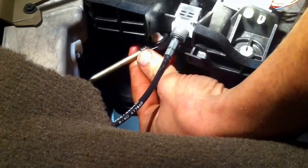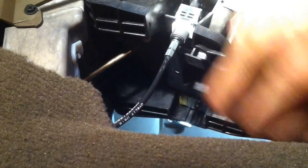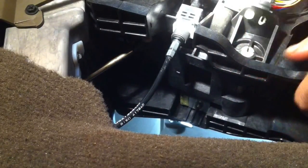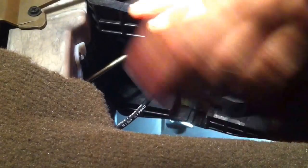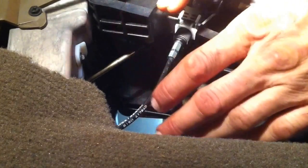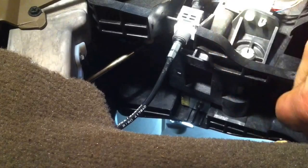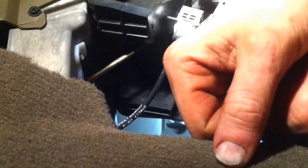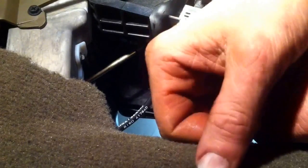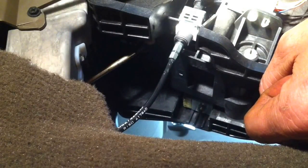As you can see, we now have our bushing on. Reach up slightly and push towards the passenger side — snap — our shifter is now installed, and we no longer have the play that we did. Now it's just a matter of reinstalling the front portion of the console, then the middle and rear portion of the console, screwing everything down, the trim bezel, and the shifter knob. The shifter knob — just line it up on the shaft and press firmly down so it snaps in. I appreciate you watching my videos. Always stay tuned for more, and don't forget to subscribe. Thank you very much.